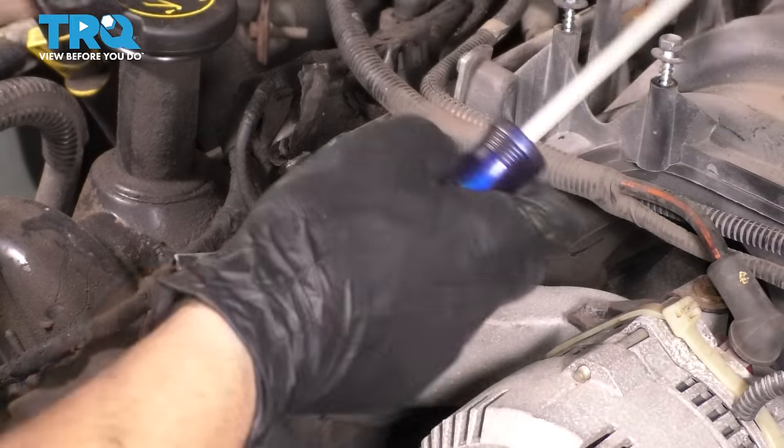All right, this is all of them. The head is now unbolted from the block, so I'm gonna set up a nice surface for it to sit on. I have some pads that I can put it on. This being aluminum, I don't wanna just put it on the floor or on a steel bench or anything that might damage the surface. Even though we are getting it machined at the machine shop, you don't wanna just destroy the surface for no reason. So let me prepare that and then we can pull the head off.